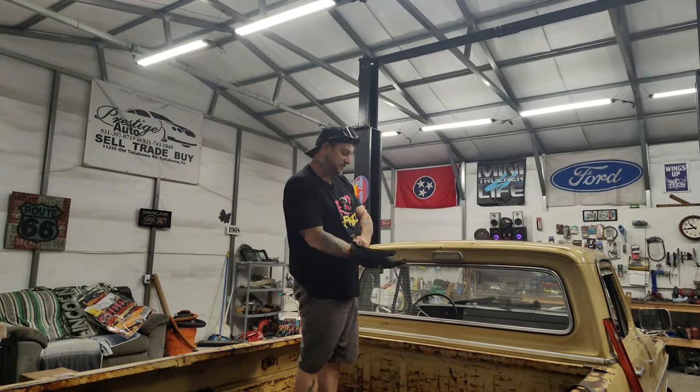As far as that wire they had hooked up with a toggle switch to the blower motor — it was simply a blown fuse to the blower motor. Swapped it out, all the controls on the AC work normal now. Got that taken care of. Now the little template piece that I made is right here — we got it painted black. It's just going to sit right there on the edge and come across, give us a little angle so it'll set pretty good in there. We're waiting on Michael — he'll be here any minute with his truck and all those parts.